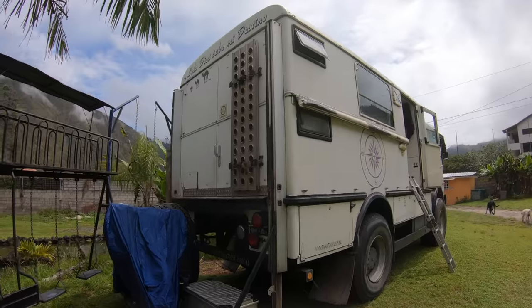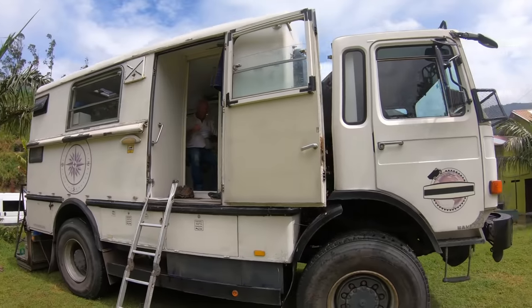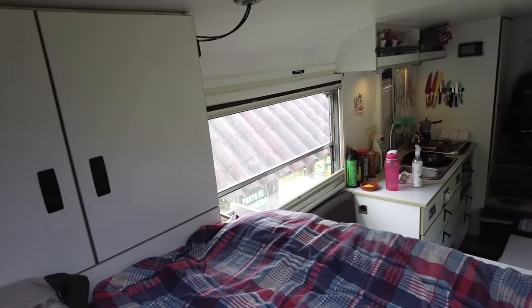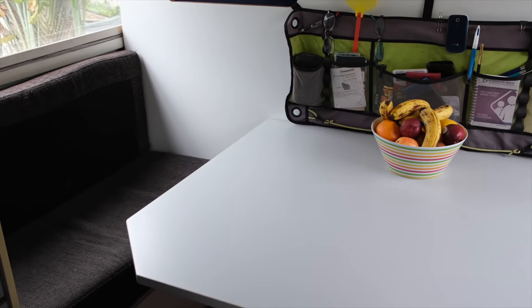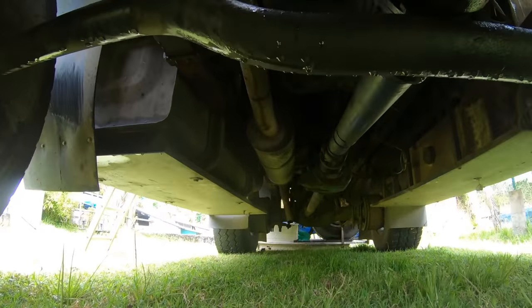Tell me, Rob, how this beast was created. This is a 1986 MAN — which is a Volkswagen dump truck. In year 2000, a German guy bought it, took the tipper off the back, sent the truck back to MAN, had it completely refurbished, then put this living quarters on — which is a German Bundespost mobile office — had it all kitted out. He went around the world in it. A Dutch guy then bought it and had the whole thing completely rebuilt again — all the inside redone, rewired, re-gassed, re-plumbed. Him and his wife didn't like it, so I bought it. This is four-wheel drive — it'll drive in two-wheel drive, and all the controls for the four-wheel drive are pneumatic. Press a button for longitudinal diff locks, press another for lateral diff locks. When it's all locked up, you should be able to get out of anything.